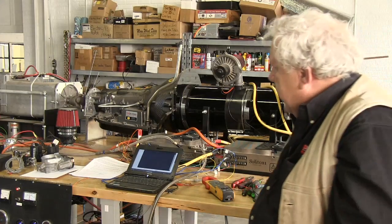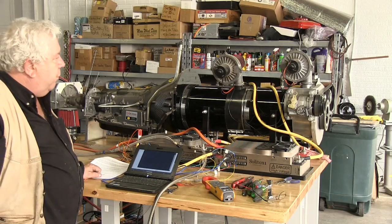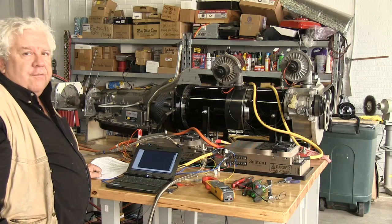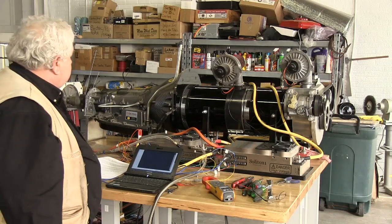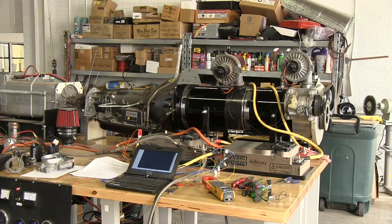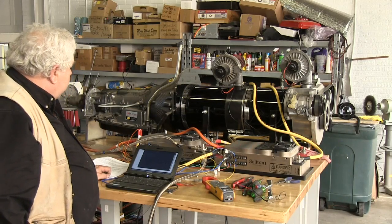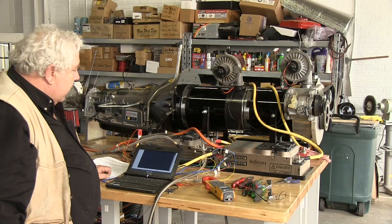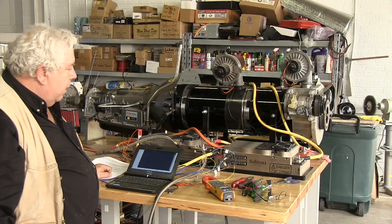Now again, our motor cooling is done by blower. And we're going to suffer a little bit of noise from these blowers, but they're absolutely critical in driving the car that we have them because they cool those motors. It's not such a big deal in here. I can turn them off and we'll be all right at idling along, but I would not want to do much with those motors. But this is running very smoothly. I've got my tachometer input from the Cherry that Brian put, and we're operating very nicely.